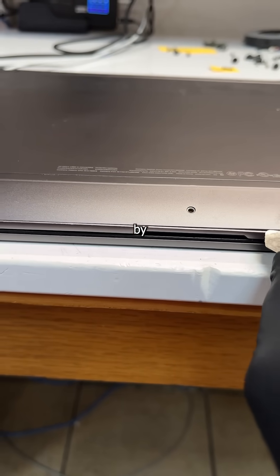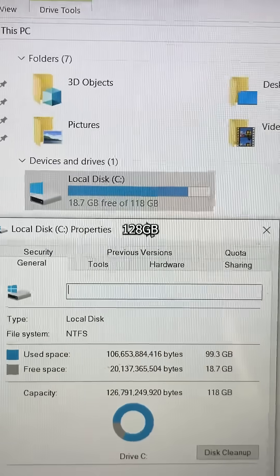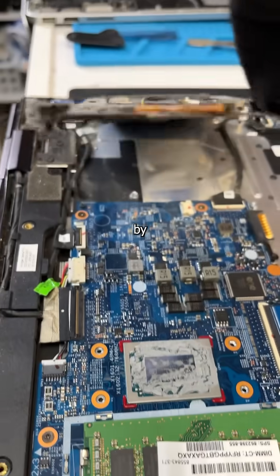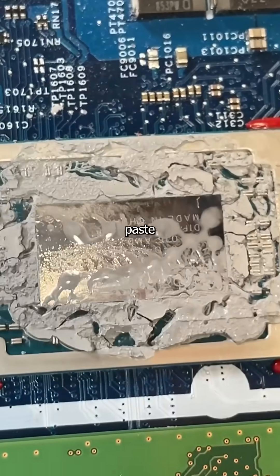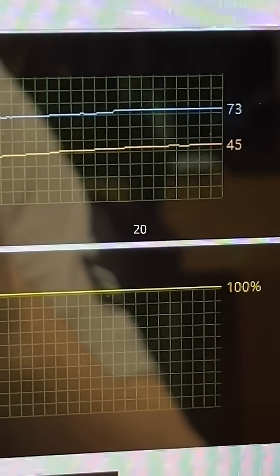I'm going to start the healing process by cracking open this metal slab and cloning the tiny 128GB NVMe to a beefy 2TB one, before tackling those high temps by replacing the questionable-looking thermal paste with some PTM7950, which results in a temperature drop of nearly 20 degrees.